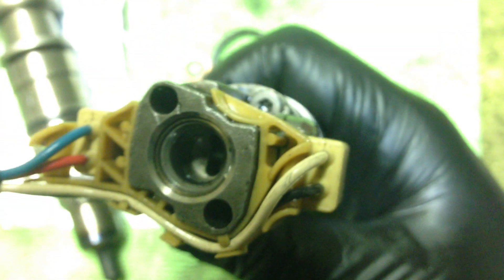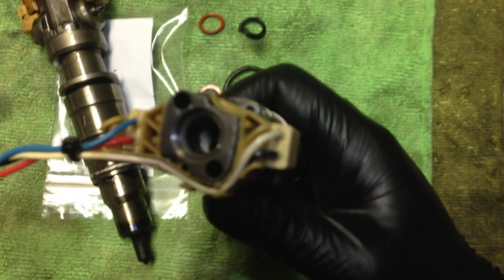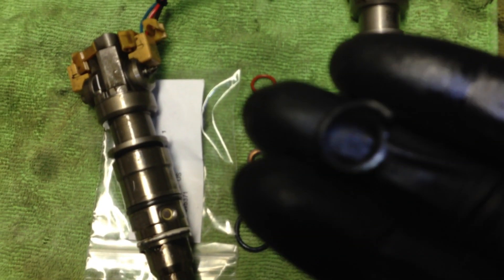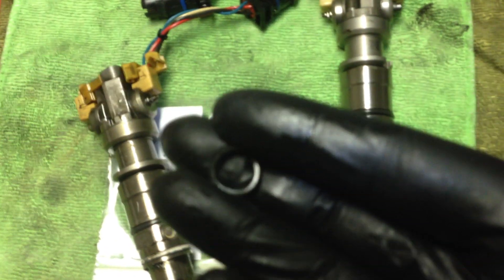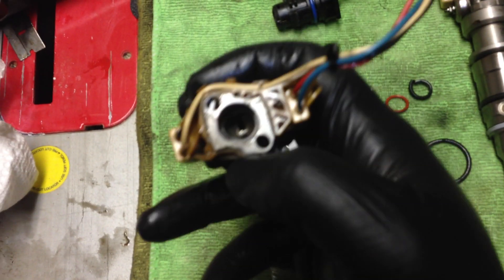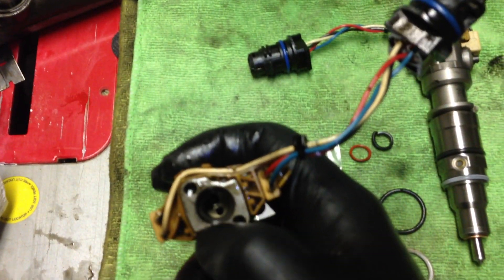Nobody really wants to tell you the secret. You can see it in there — the o-ring that's inside, which is basically this one right here — it basically wears out to the point where your high-pressure oil is leaking out of the top of your injector, causing you to have either a hard start, or it just won't start at all. It doesn't matter if it's hot, cold, or you use a block heater — it doesn't matter.